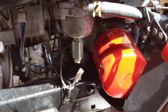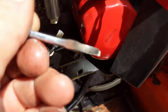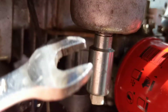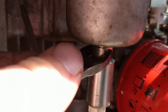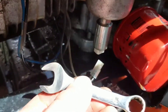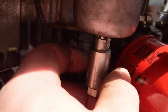Now, to remove this you need to make a tool. What you do is take a half-inch open-end wrench like that and grind it down so it's narrow, because if you look at the top of the solenoid, there's actually a half-inch flat spot that you can slip a wrench onto and spin this off. Generally a regular thickness wrench won't fit in between, so I've ground this wrench down. I've used it hundreds of times for this job over the years and it's worked perfect — I dread the day I lose it. So you crack it loose and then you spin this off.